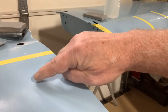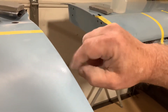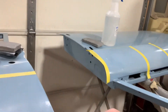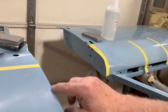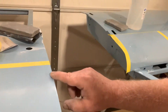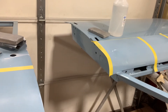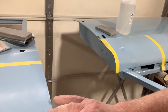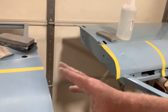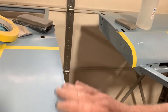Keeping trash out is very important — do not get any grit between the wet sandpaper and your fresh paint or it'll leave scratches. You can see the little divots in there; those will all block out. On these edges, be super careful as you sand, because these edges will not collect the paint and clear like a flat panel will. It's very easy to sand through your paint on edges. Also make sure you don't have any trash under your paint, because if you sand over something you've primed and painted over, that trash will show the color of the paint beneath it.